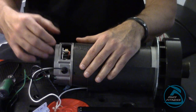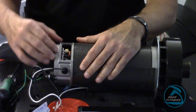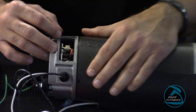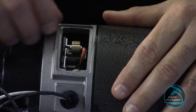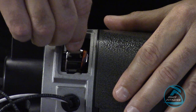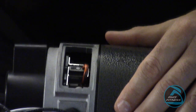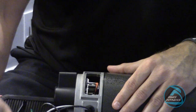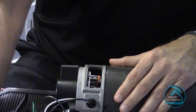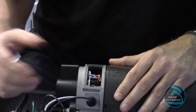This is the compartment for the motor brush, retained by this clip. In a moment I'm going to pull this clip out — it's spring loaded. I would recommend making sure you have a good grip on it, because if it pops on you, it could go somewhere and then you wind up searching for it for quite some time.